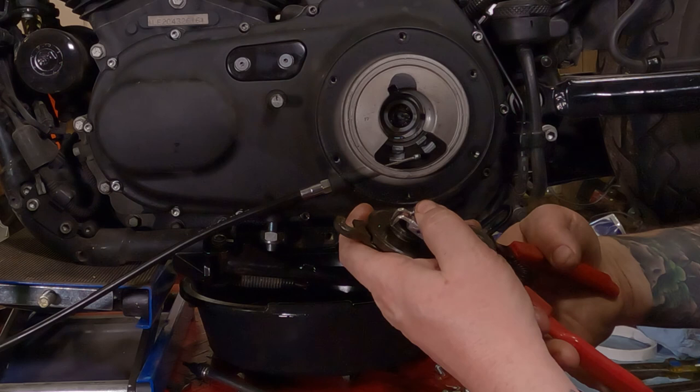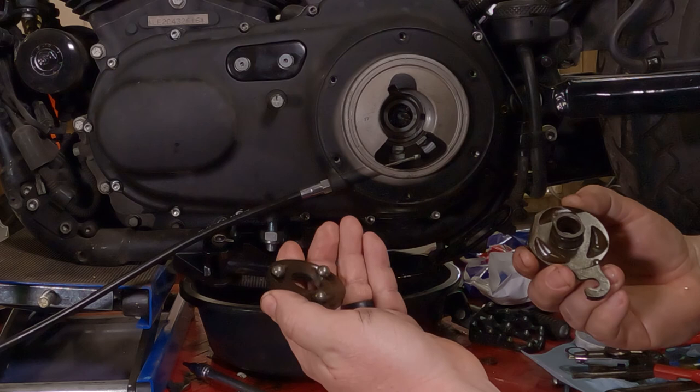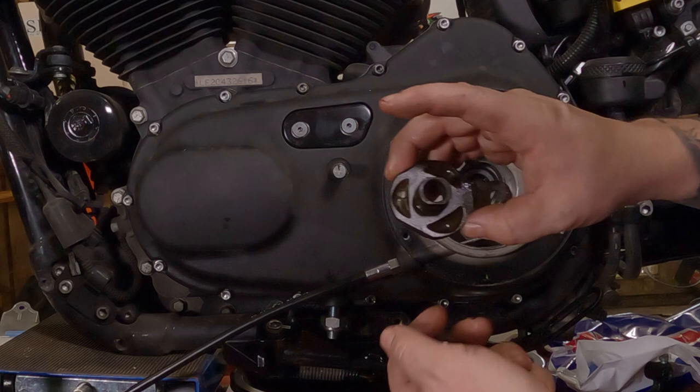So you can take this snap ring right up off of there. Set the snap ring at a safe location. Hold this flat and lift up off of here. Now you can see down in here, I'm going to tilt to the best of my abilities, without losing them. There's three ball bearings that go in there, and they ride inside these ramps here. Now is a good time to give a visual inspection of the ball bearings and of the ramps. There should be ramps in here also.